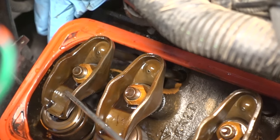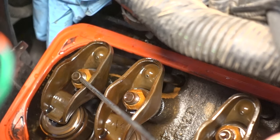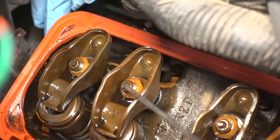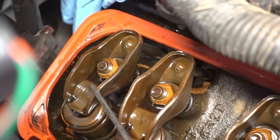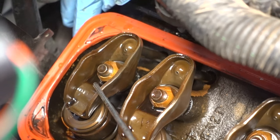What I'm going to do now is start the engine, loosen this bolt until it starts clacking loudly, tighten it back up slowly until the clacking goes away, and then give it a final three-quarter turn. I might do the same for the intake valve. I'm really hoping I'm onto something here, because if I can take care of this ticking sound, it is going to make me happy.